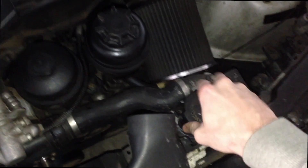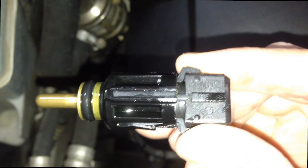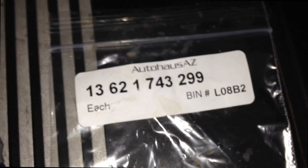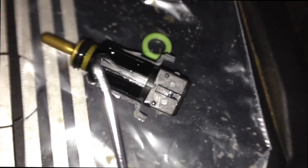Now tighten that back up or you're going to leak coolant on the ground. Now I can go in here and pull this temp sensor out. To get it out it's just these two clips — push them in. That's my new O-ring, it's already on there. The old O-ring is right here, and here is the part number. Use an O-ring pick tool to take it off, put the new one on, and put this back in.